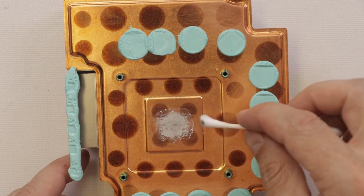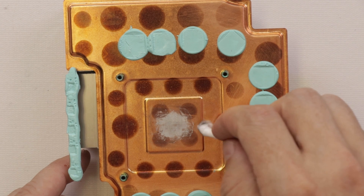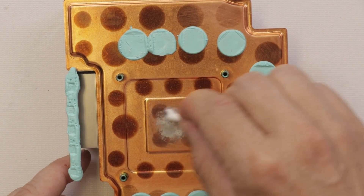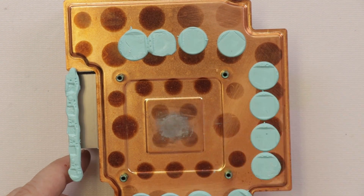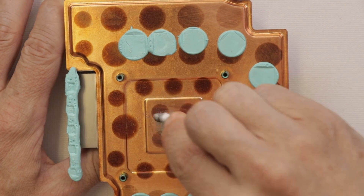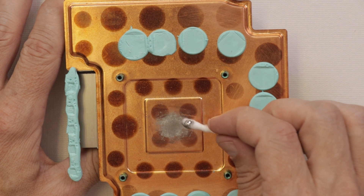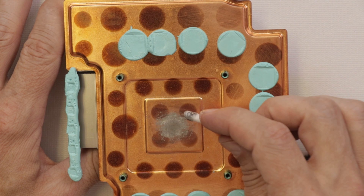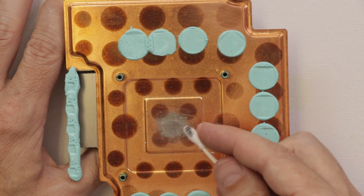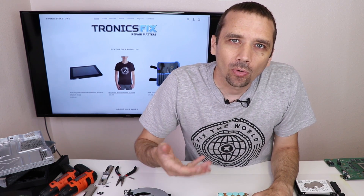Now it's time to look at the heat sink. This is the part that some people say will get damaged with liquid metal. It's definitely pretty scratchy. I know liquid metal can't really dry, but it almost seems like it's dried out or something. This liquid metal is coming off in chunks — I don't know whether that's just the liquid metal or part of my heat sink as well. Those are pretty big chunks of metal. Before I do any more scrubbing on the heat sink, I'm going to look at it under a microscope to see exactly what's going on and if I'm pulling up liquid metal or parts of the heat sink.